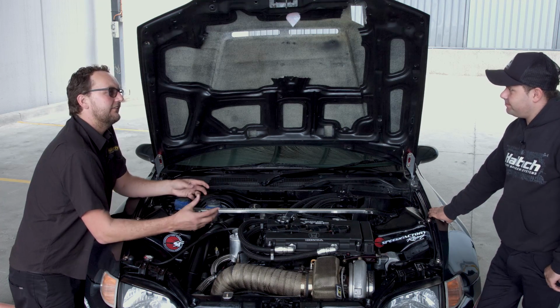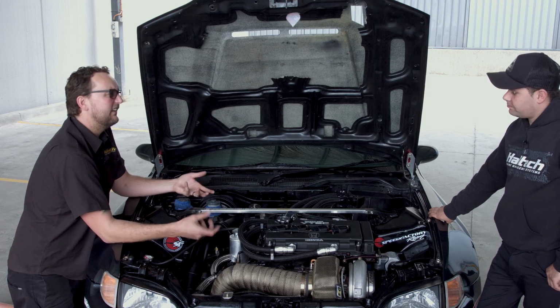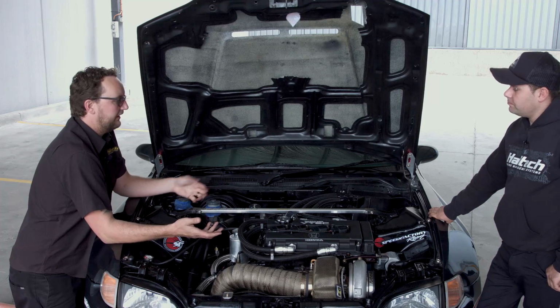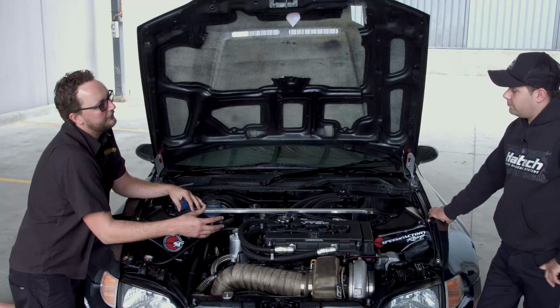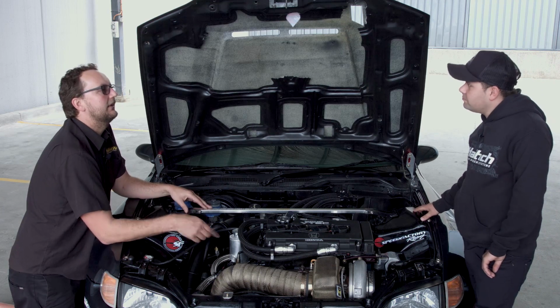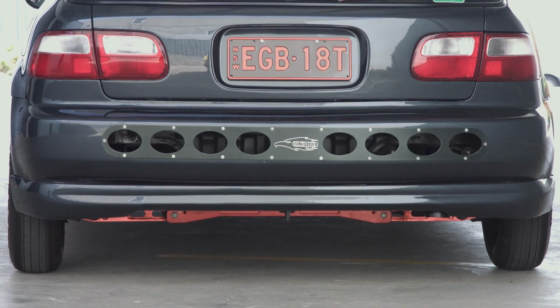Staging them's a really nice idea, because that way you've got one 044 pump that runs at idle, so they're fairly quiet, and you're not recirculating all that fuel as well, which helps. Where if you had 3 pumps running flat out all the time, you've got so much fuel getting bypassed and heated up for no reason. So the staging is a really good way to do it.